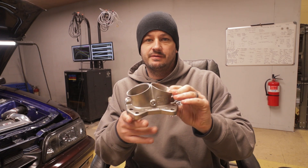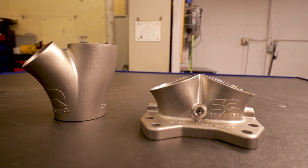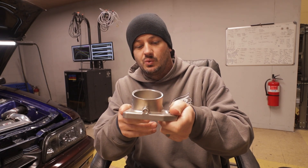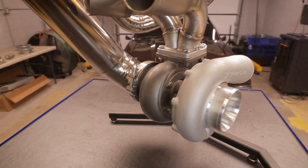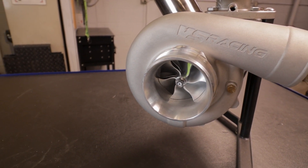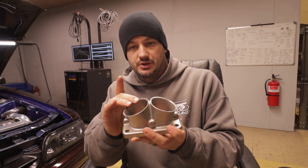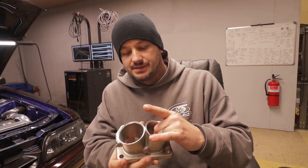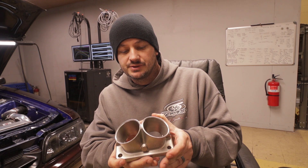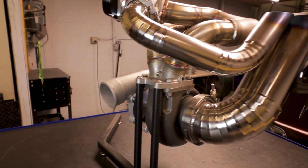We've made it this far into the video, it's time for a giveaway. The winner will have their choice between a Sequence Manufacturing or Stainless Bros T4 or T6 turbo flange. It has provisions for mounting the turbocharger to support the weight of the turbo without having to weld anything directly to the piping. There are 1/8-inch MPT bungs in multiple locations for either back pressure or EGTs or however you choose to use them. They are investment cast, machined, and decked flat. Unlike some other options that can be very difficult to fit in the car because they're so long, these are pretty short — but not super short like some options where you get really harsh entries into the turbo. Everything was CAD designed to flow as good as possible while being as small and easy to use as possible, and the inlets are splayed to allow for easy welding on the inside.